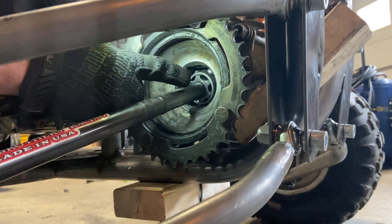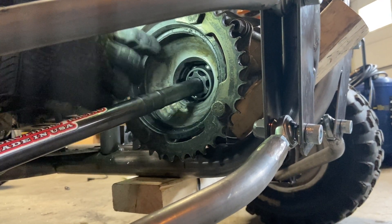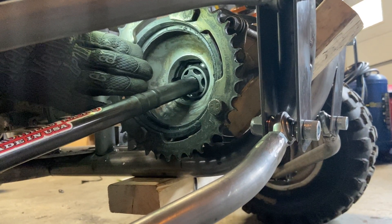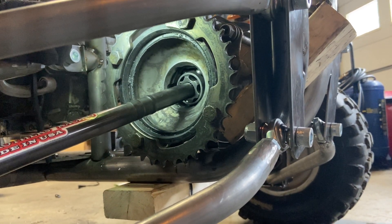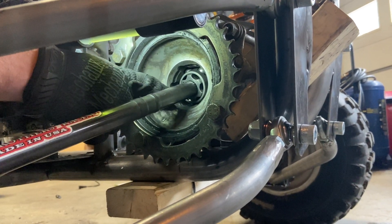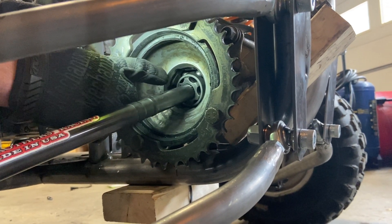Plunge is where, when you go through your suspension travel, your axle moves in and out along those races. That's something you have to adjust when you're building your own, and your limitations are this little ring in the front. You can see the ridge — a little snap ring goes in there to keep the axle from falling out if your CVs blow apart.